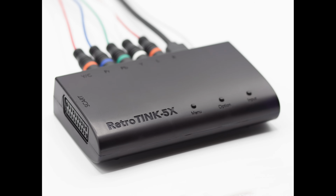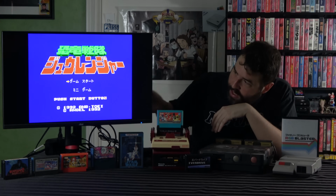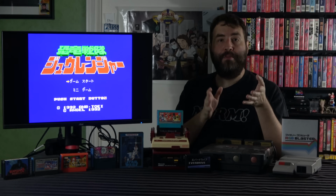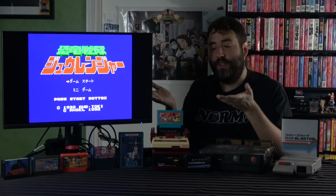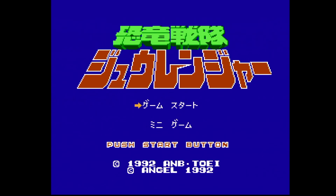Basically, the system is set up and is feeding into a RetroTink 5X. My particular setup is the HD Retrovision cable, as mentioned before, and then it feeds into that. And then, there you go, you can see it immediately. The RetroTink 5X takes the 240p signal and upscales it to 1080p, which is a much more basic modern resolution that the monitor has no problem understanding. And as you can see, it looks great. I'm going to let it cycle, even though the lighting will be off a little bit, but you can just see how clean and clear the video signal actually is.